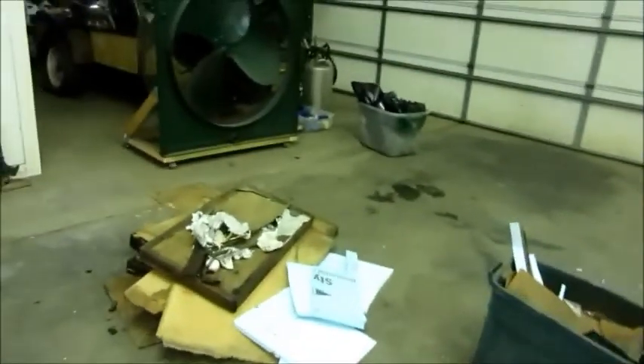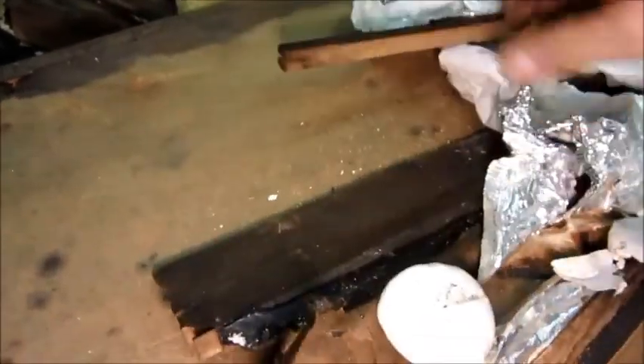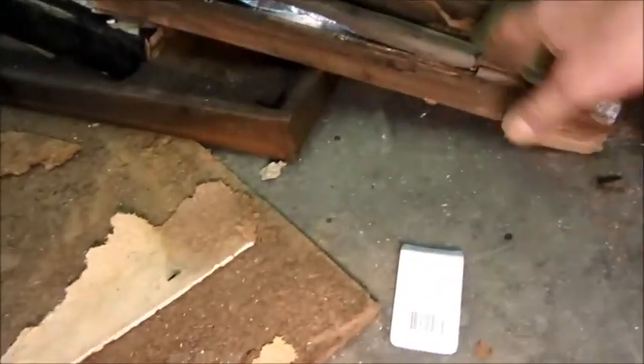So today I did a lot of insulation work. I didn't video that because it was just not really worth it. The original insulation were these panels, and inside there are layers of metal foil — I'm guessing it was like a multi-pane window with air trapped between them — but most of it was already pretty well deteriorated. The insulation in the bottom is just gone. That's what this piece came from. This was in the sides and the outside of it, and I replaced that.